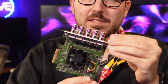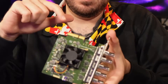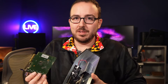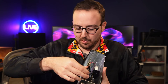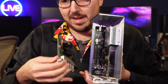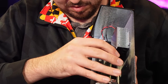Here is our Decklink Duo 2 card. You'll notice that it has five SDI connectors — four of them are going to be SDI outputs and one of them is reference for timecode. On this side of the chip there are golden connectors; that's what's going to plug into the open slot on your board. What we're going to do is take those golden connectors and face them into the direction of the board. The SDI connectors are going to face down because they're going to go through the slot at the very end, so I'm going to tilt this and adjust it into position.